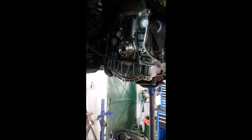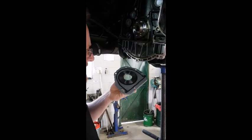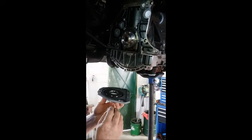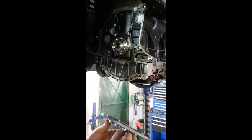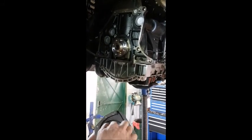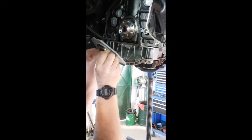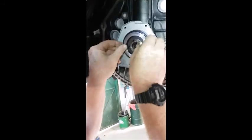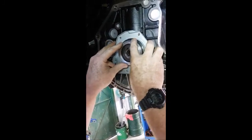We are at the rear of the engine where the seal mounts to the back of the block. You can see we've put a nice layer of sealant around the seal housing and primed the back of the block. It's simply just a matter of slipping the installation tool over the spigot in the hole — this is quite a precise hole, so there's a bit of wiggling to get it on there, but once it lines up it'll slip in there beautifully. We hold that up against the end of the crankshaft and feed the seal on.